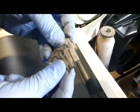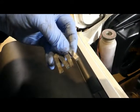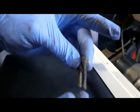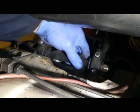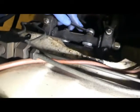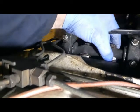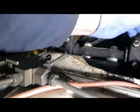At the rear I'm going to take one of those 1mm shims out and put in a 3mm — in other words, increasing it by 2mm. The overall effect will be to increase our negative camber as well as giving ourselves a little bit more positive caster angle. I'm also going to add 2mm to the front end.